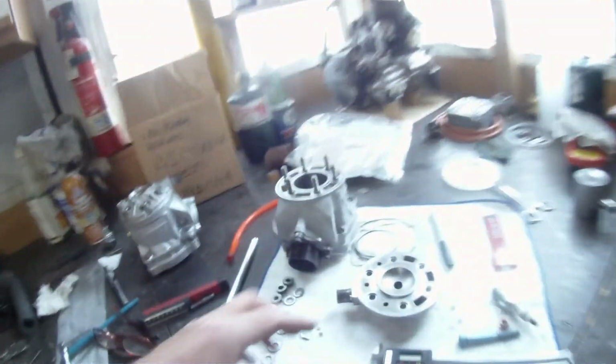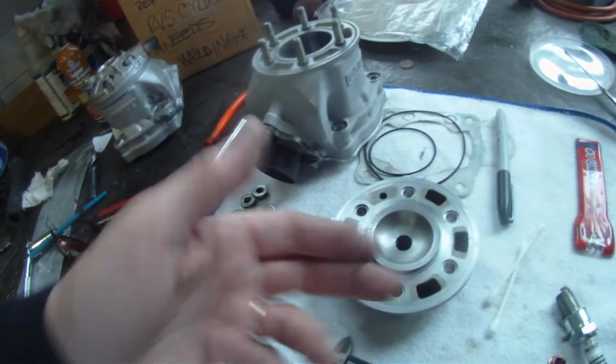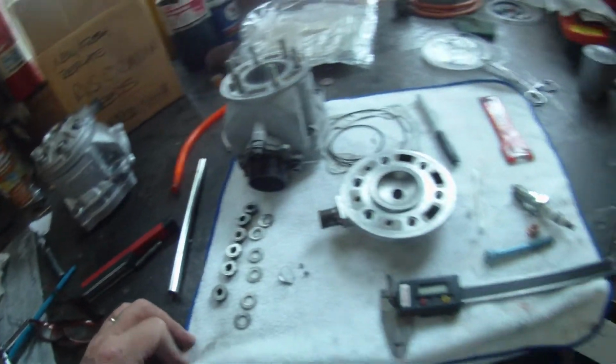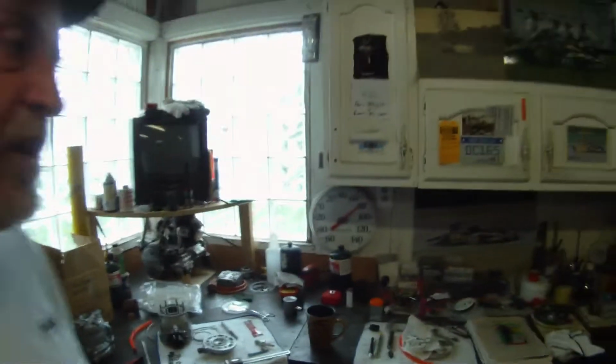Inside of the head, the crank weights had oil all over them, plenty of fuel. It wasn't lean, no air leak. The head, as you can see, is wet and shiny, although it's got a haze of aluminum dust on it. So it wasn't an issue where it ran lean or it was leaking air.